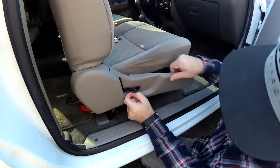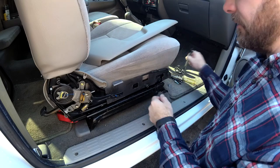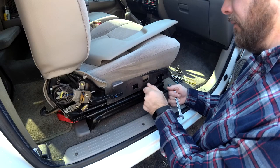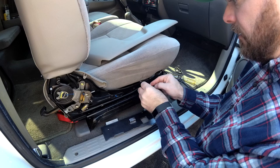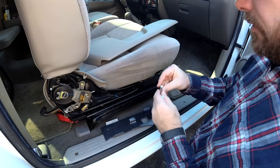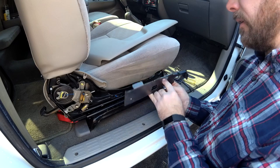This is gonna be different on non-extended cab vehicles because I have this cable and this little housing that holds the cable back here, which has basically a nut — that's why it has a factory bolt here, and the other side does not. So I'm going to back out this bolt, which should be the same size. Double-checking the instructions: lock washer, flat washer — that makes sense. Then on the inside of this bracket we're gonna stack four washers. The passenger hardware kit comes with a whole extra stack of washers.